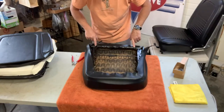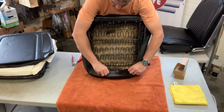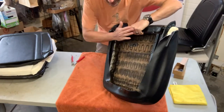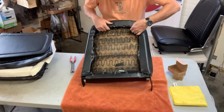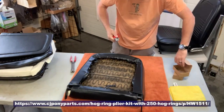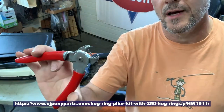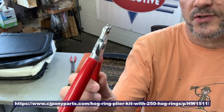It's nice on the bottom — they have them placed; nice on the top — they actually have placement of them too. You'll see a combination here: the circle and the place where you want to attach your hog ring. You would cut through the material to get to the circle. What about the sides? There are springs there — you're going to want to squeeze this around and attach to the springs. This is never going to be seen once you put the back on. Coming along here, I got the sides now done. These are nice little hog ring pliers — you can order these from any distributor, usually as a kit. You'll see how they just spring on — this is spring-loaded, it holds it in place for you. That's great because you're getting something in position and you just want to grab this and snap it on.